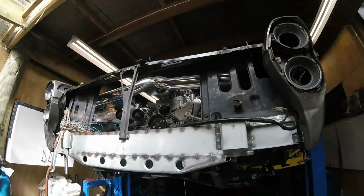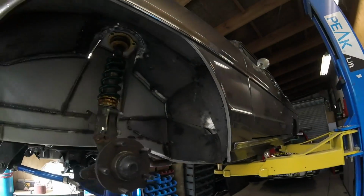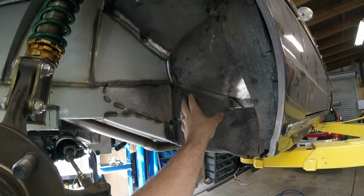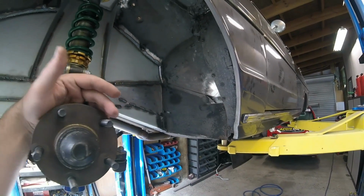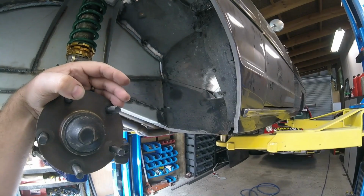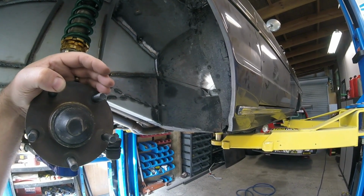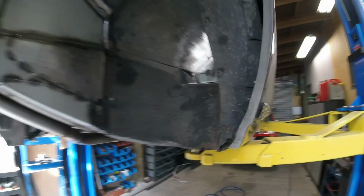So I got that far, and I was like, right, let's figure out where we're going to put our ECU. A lot of Nissans have them in the passenger footwell area, which is here. So on the other side, obviously, you don't put it in the mudguard wheel arch area. So cleaned up the inside, getting ready to do that. Have to take all the sealant and everything away so that you can weld your little brackets and all that sort of carry on. As soon as I started chomping into the sealant, yeehaw, big patch of rust.